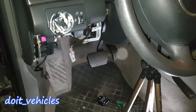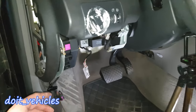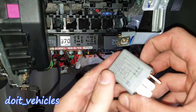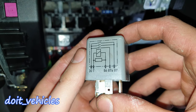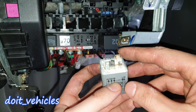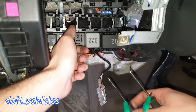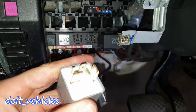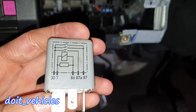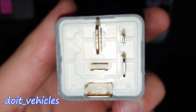Next, I'm going to take as an example the fuel pump relay and the fuel pump fuse. If you have a diesel engine it's gonna be more complicated because this relay also handles the glow plugs. Fortunately this car is gasoline, so this relay is responsible only for the fuel pump. If I take this jumper cable and look at the diagram, you can see that pin number 30 and pin number 87 are for the fuel pump.